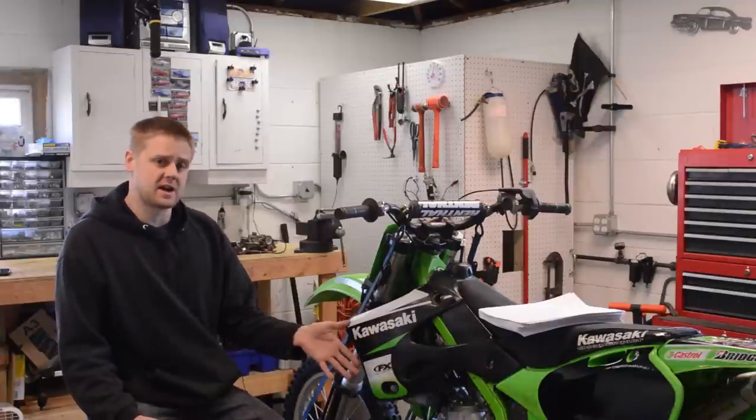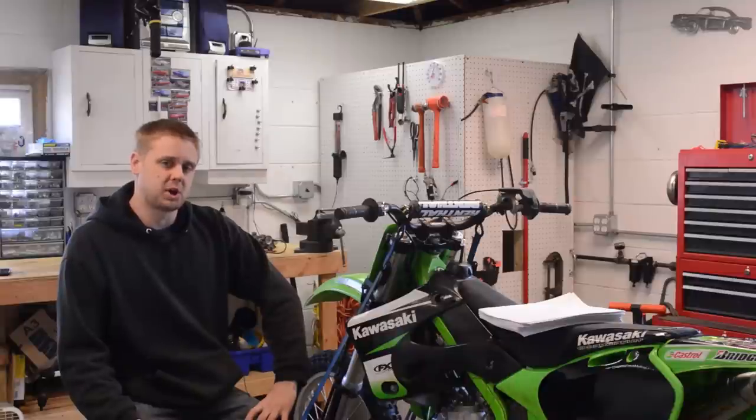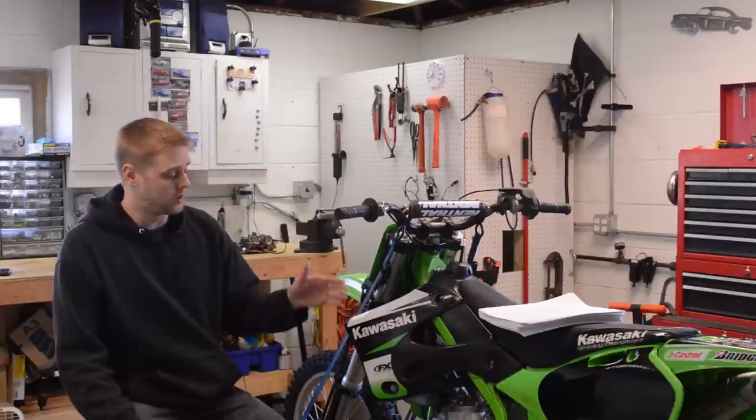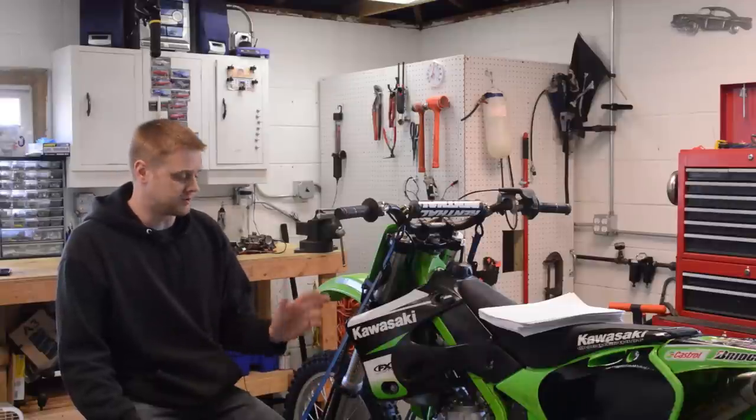So basically, Kawasaki has the electrofusion version of Nikasil. It's their proprietary plating, and it's known to be not the best. I think in 03 they went to a different plating technique or process. But anyway, they don't last all that long from what I hear. So I sent this out to Millennium Technologies to have it replated, and that should be good for 100 hours or so. They did a real nice job, and the cylinder looks awesome.